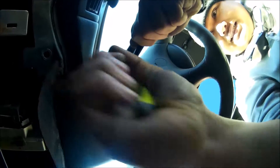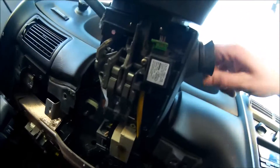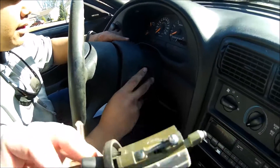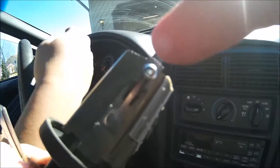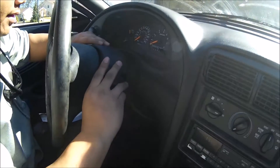So if you unscrew the steering column adjustment bar, you should be able to. Now we should be able to take that top cover off with the ignition switch removed. The way we did that was put the key in, push this little ball that you should be able to see, and it just pulls right out after turning it to the accessory.